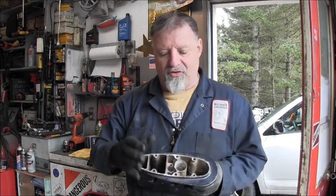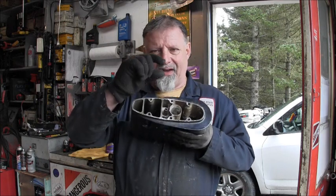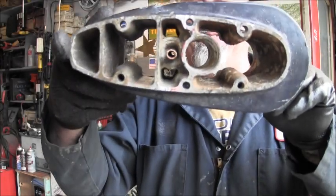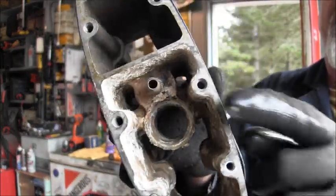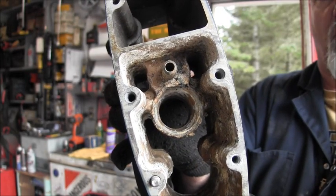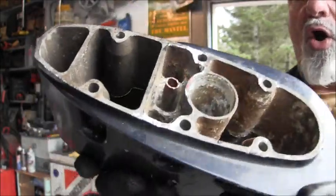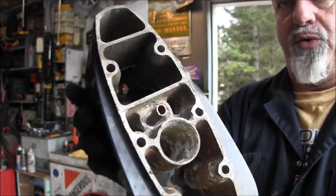And the reason why I said just take a couple of cold chisels that have about a half inch of thickness to them and hammer them in there is, I don't know if you can see it real good, but you're not getting that out of there. There's the water pickup tube right there, and you can see that's welded. So you've got 4 inches of solid dissimilar metal corrosion holding that section of water tube in there. And you can bang all you want. That is not coming out. Been there, done that, don't do it. You ain't gonna get it.